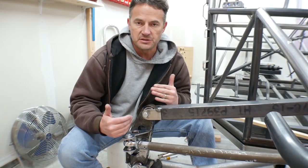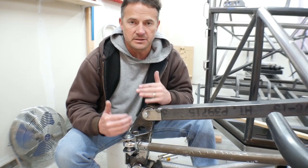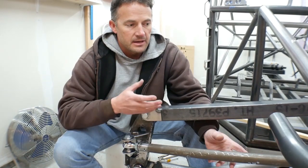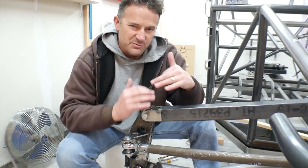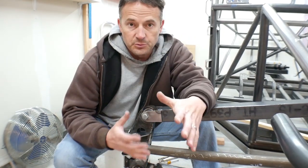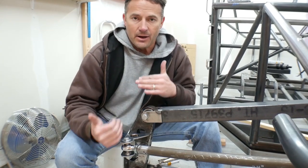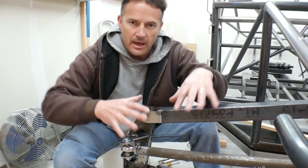What I have here is a geometry setup that gives me pretty decent Ackermann. We know this is not optimum Ackermann and it's not going to be perfect, but this is better than I had before because I moved this steering rod pivot point as far outboard as I could. I also got myself the proper geometrical length of this tie rod so that, although I had to move it a little bit off the pivot points, it's pretty much right on where it needs to be. So when my suspension goes through the travel now, it's really good — better than my other Baja and it might have better Ackermann. I can't move the steering rack back at all because the steering links drop down at full droop.